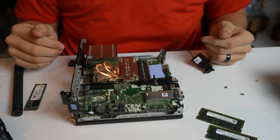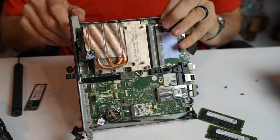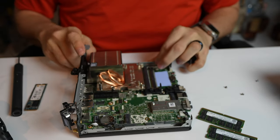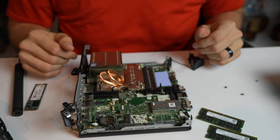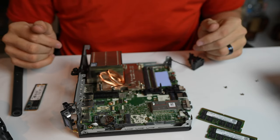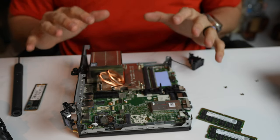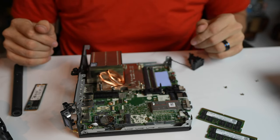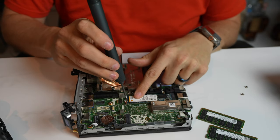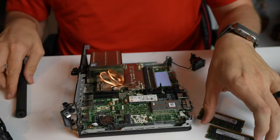If we wanted to go as far as removing the heatsink assembly, it would just be these three screws here. It would be this one here, and this one here, and this one here, and that's going to let us get this heat pipe assembly off and get to the CPU. Really, the only time you would ever do this is if you were going to change the thermal paste, which, stay tuned for the next video because I'm going to be doing a full review of this machine, and it gets toasty. The reverse assembly, we're just going to get this and screw it down. Nothing special here. That's in.